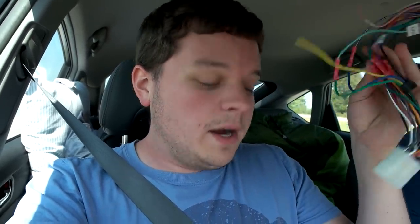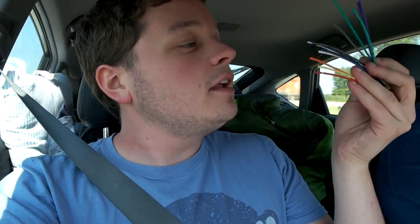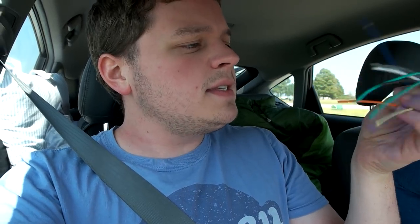While we look for a Walmart, I'm going to take the wiring harness that I pulled out of my Chevy Prism, pull all the wires off of it, and connect it to the new wires. It looks like it's pretty straightforward — just match up each color. The only inconsistency is that there is a blue wire, and the harness that attaches to the stereo has a blue and white wire.